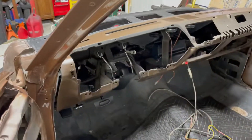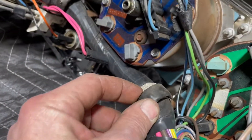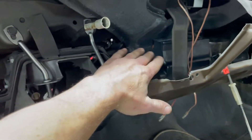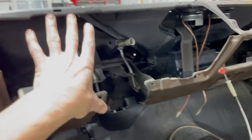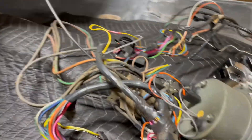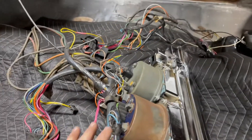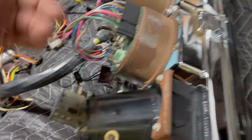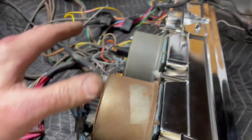I've got to get this thing in here with two hands. The reason I'm putting this together as a unit is because it has these hooks that basically funnel the harness directly behind the instrument cluster to keep it there. If it's just flopping around, you have a really hard time getting this pushed as far in as it needs to go. So the best way is to get the whole harness installed, everything plugged in, everything tightened down.